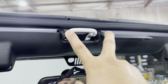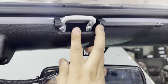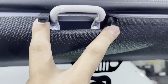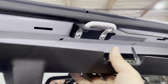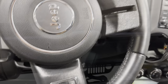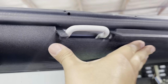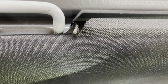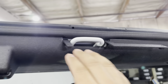After you take off this bracket from the six-panel switches, you put it on with the footman's loop over it. Then you need to put this piece in — line this up with that hole, put it on right there, and you're going to need to trim it so it can pop all the way in. I got a white ink marker and put a little line where I needed to cut, then trimmed it with a Dremel — I went down and then both sides. It clears now. I test-fit it by pushing it all the way in until it clipped to make sure I cut deep enough without cutting too deep. It fits good now.